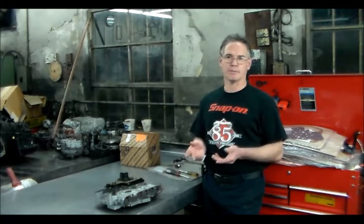So what I decided to do as a test is I have another, it's a 60-way connector, kind of like a Caravan, and looking at the wiring diagram, most of it was a lot the same, like the power and grounds were the same. So when I got it to happen, I took the connector out, put it into this other computer, to see if it would start. It didn't start. And I know that computer's good, so the computer is not my problem. I was lucky enough to have a computer here. So I move on to the next thing.